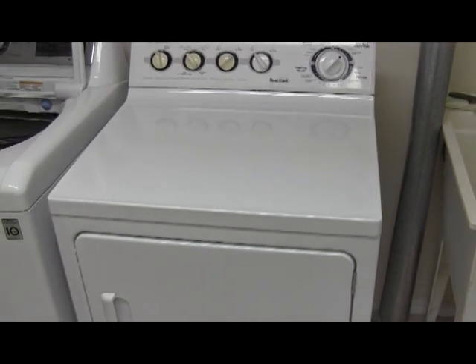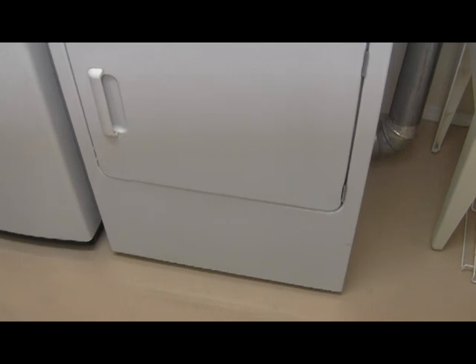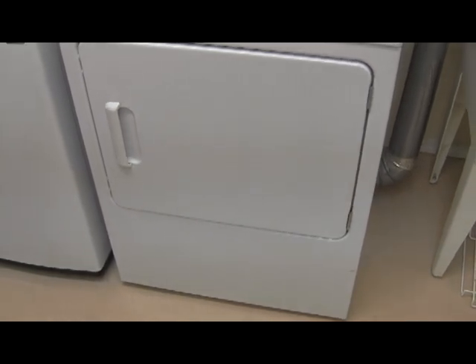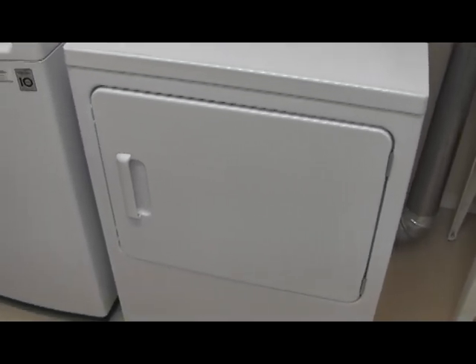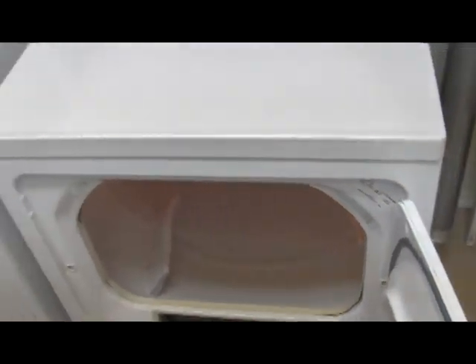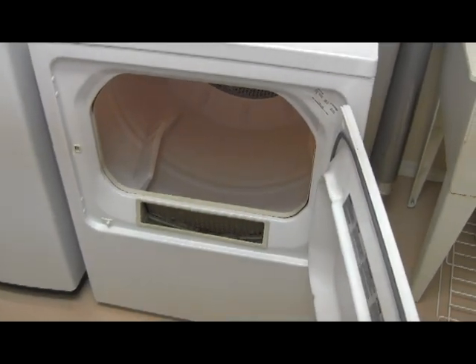Since then, every two years I've again cleaned the dryer. At the two-year point when I first took it apart, I found a hard lump of lint at the bottom left-hand corner about the size of a person's fist. At the four-year point I took it apart again and there was no lint there. At the six-year point I used a leaf blower and just blew out the area in here — once I had vacuumed it, I then blew it out. Today is the eight-year point, so we'll be taking the dryer apart to see how effective my procedures have been.